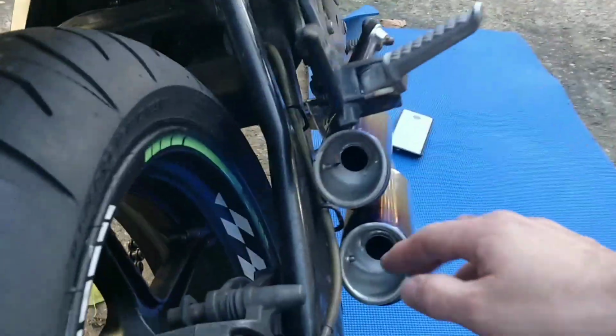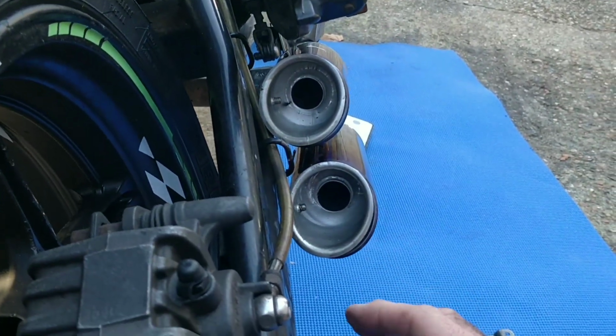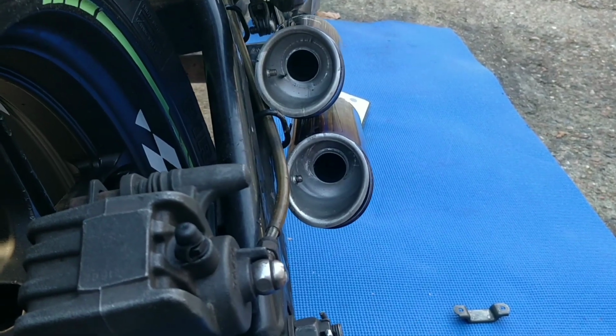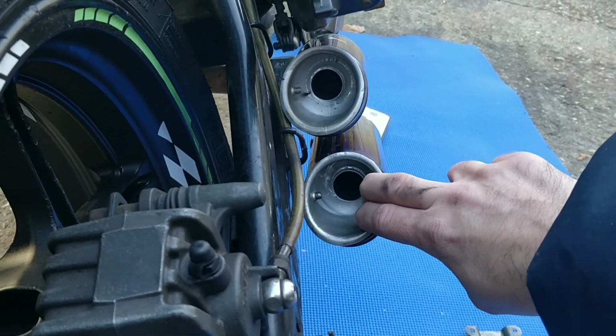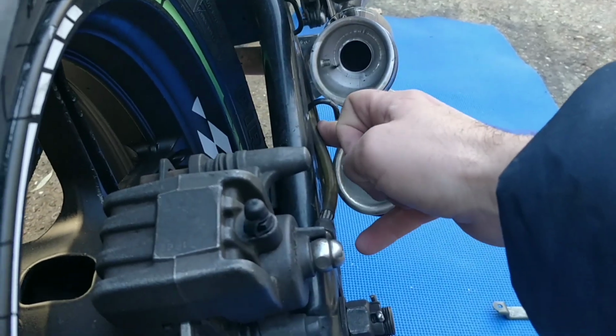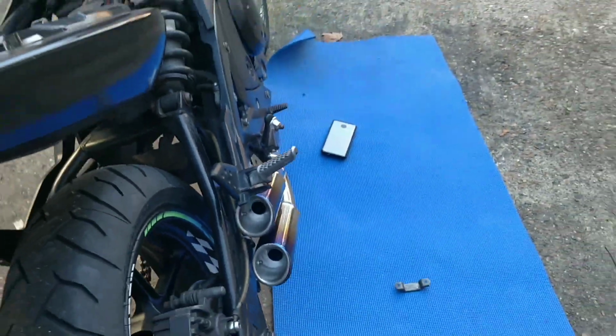John was concerned about the exhaust being so close to the hose, but that's where the brake hose was located originally. So the exhaust came up here originally, so we'll pull this away a touch. Maybe I'll throw a cable tie in there to tuck that away a little bit, giving it a gap, and then we're absolutely spot on and ready.